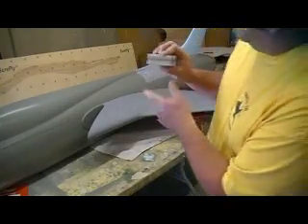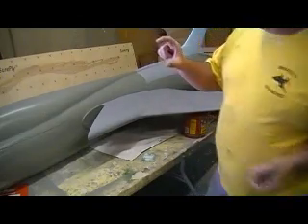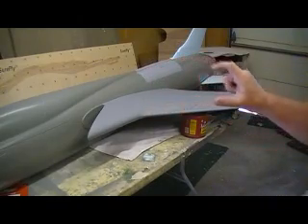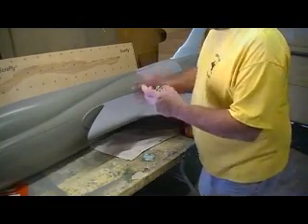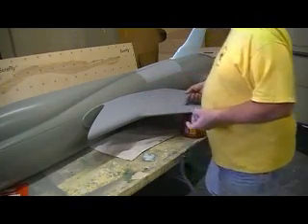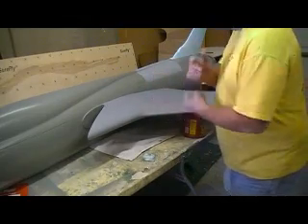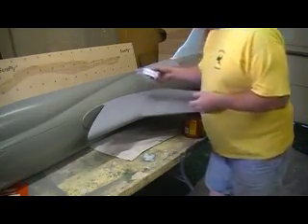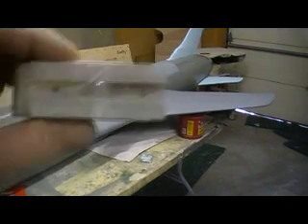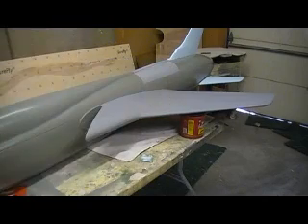We bolt this to the bulkhead, run our aluminum out here. It'll be like quarter-inch wide, about three or four inches tall — whatever the thickness of that wing is. It kind of comes out and tapers because it actually goes through the wheel well, tapers down toward the strut, goes in between the gear and the tire. I'm thinking we could just make some channels like this, bolt them on a bulkhead, and tweak them down to that one degree — and we'll have our one-degree dihedral.